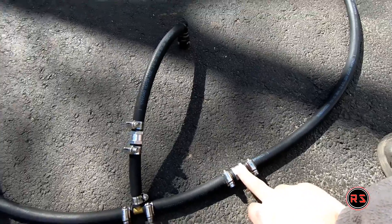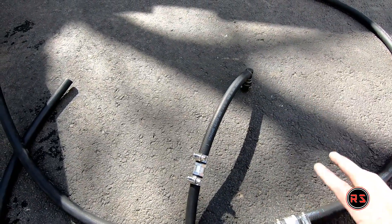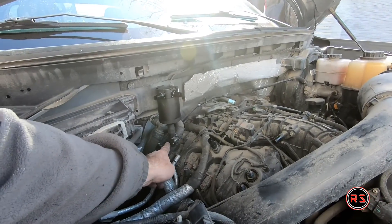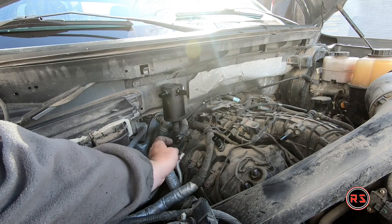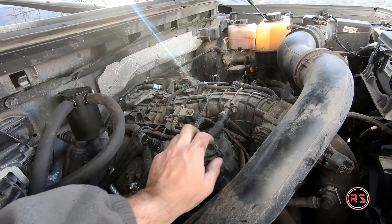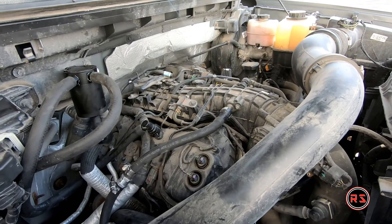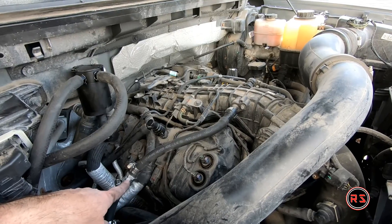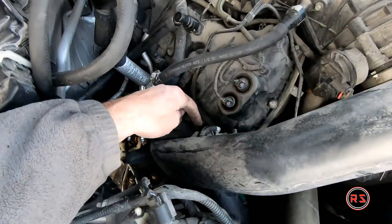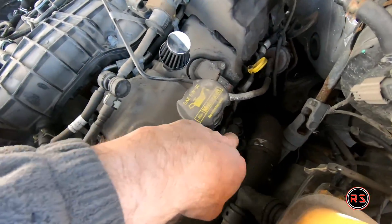This end goes to the turbo. When the turbo sucks, it won't pull air from the intake because I put a check valve there, so there won't be a disruption between those two hoses and I will have a constant vacuum sucking into the catch can. There's a hose here where I plugged the tip temporarily because I haven't received my valve kit yet — I will install the valve now. So to recap: the hose from the intake now has a check valve going to the catch can, and there's another check valve going to the turbo underneath.